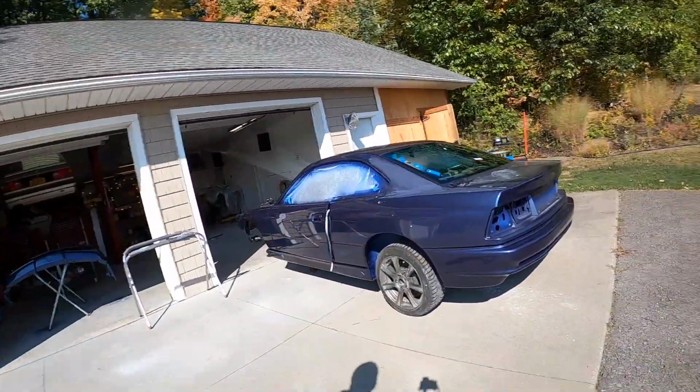You're talking about noises while driving at high speeds if you don't put the urethane on properly, delamination if you don't put the primer on properly. You might not seat the seal on properly, and there's so much room for error that with a $700 rear windshield and an $800 front windshield, you don't want to make that mistake at all. So I left it to the professionals. They did a great job. Here, check it out.